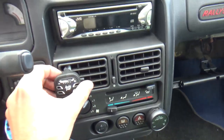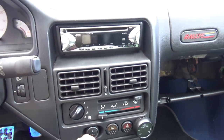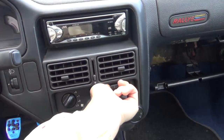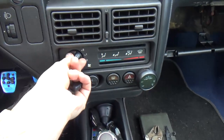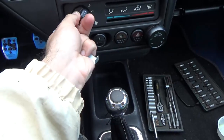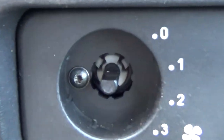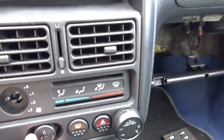First thing is to start removing the radio. I'll pull these controls out, pull the knob out. It's out and there's a little X screw under there. I'll remove that as well.